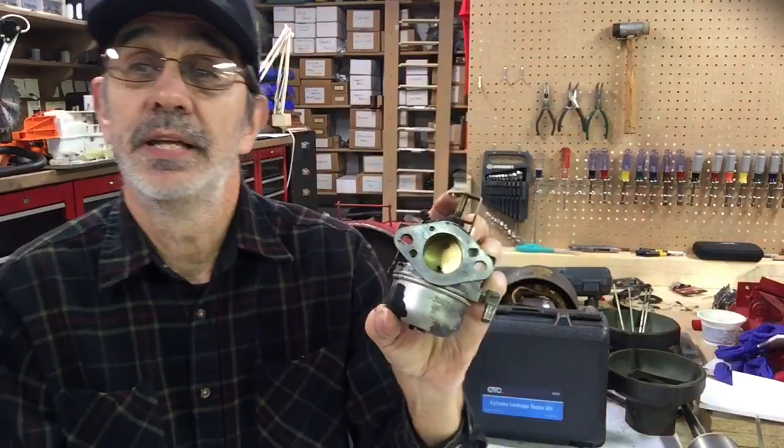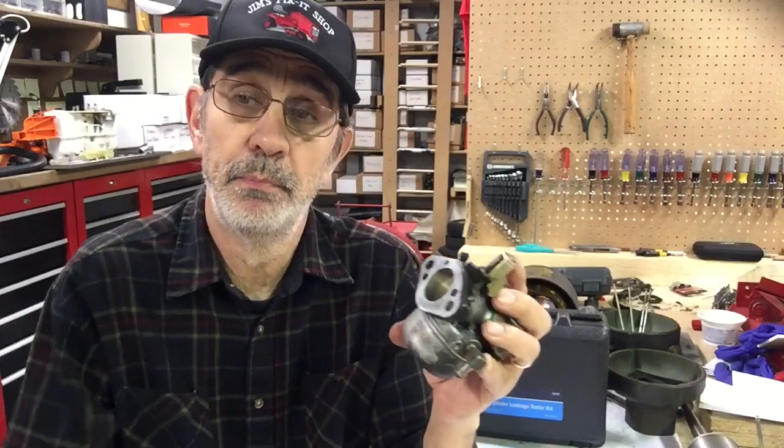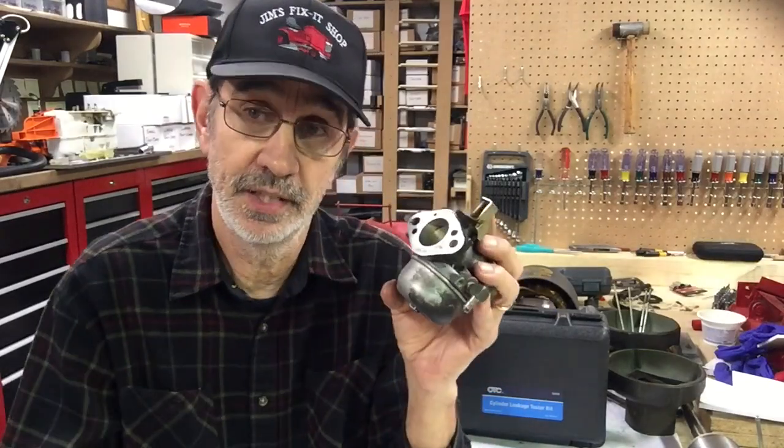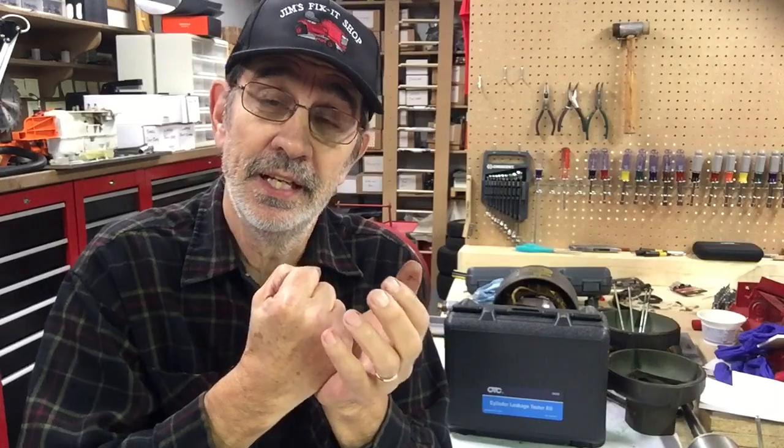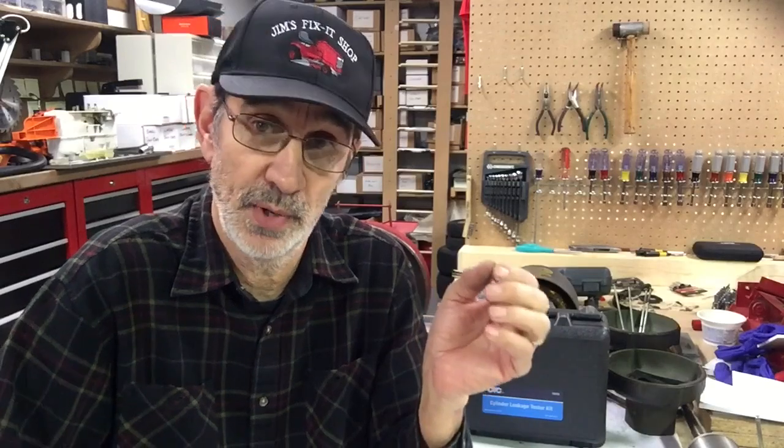Yeah. Now, this has happened before. The last time it happened, both screws fell out and got sucked into the engine. And one screw was embedded in the top of the piston. And the other screw, I can't remember where we found that. That was laying over by the valves, I think. Well, I think that's what my compression problem is, that screw is getting under the valve and then popping out. And so I got to pull the top of the engine off. I'll do that online.